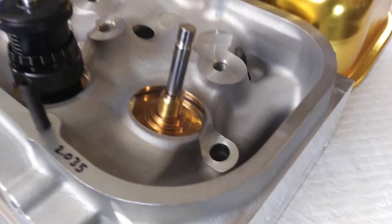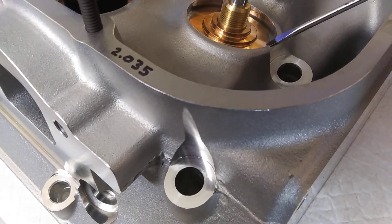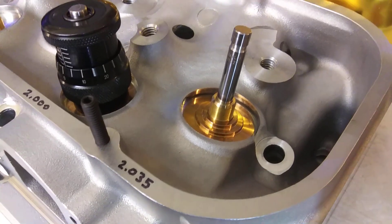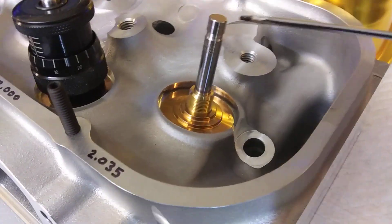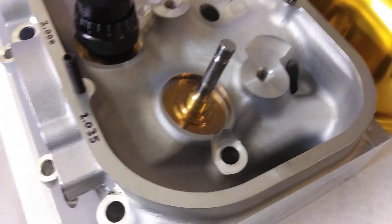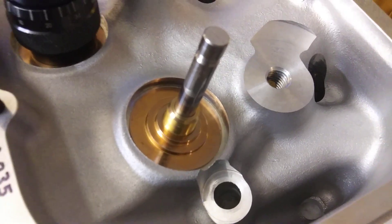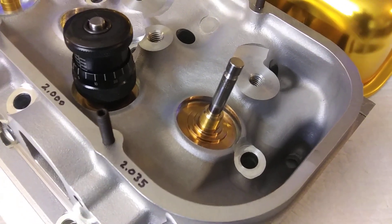But I don't like running that many shims, because you get too many shims and then your locator comes up. You'll either not get your valve sealed all the way down if you get your locator jacked up real high. So it's best to minimize your shims. Best thing to do: I'm going with a .050 lock — that'll make the retainer 50 thousandths lower than a standard lock. So you put that .050 lock on there and that leaves .045, so a .030 and a .015 shim under that locator, and that'll put it at 1.940 without a big stack of shims.